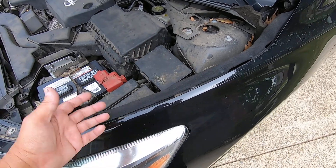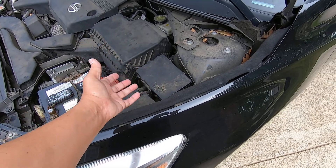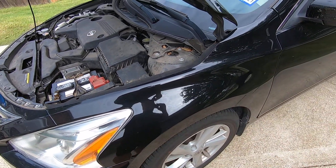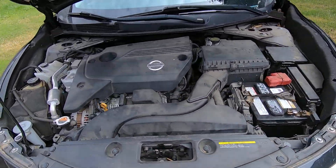These do not have to be programmed. If you were to buy one of these used or even new, you just unsnap it, unplug all the connectors, plug the new one in, snap it back down — you're good to go. No programming necessary. Just make sure you get the right part number, as there are different ones depending on your make and model.